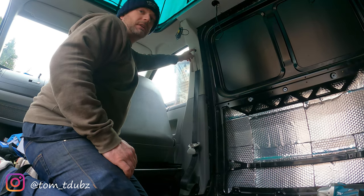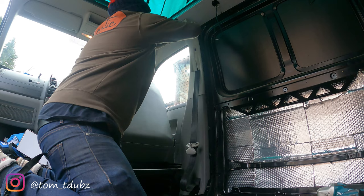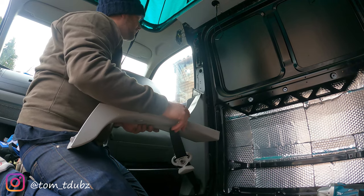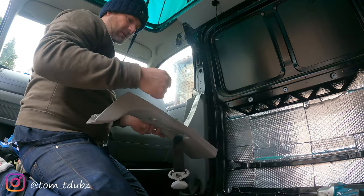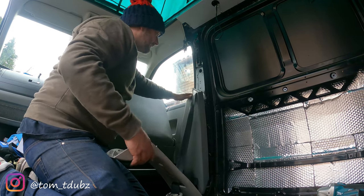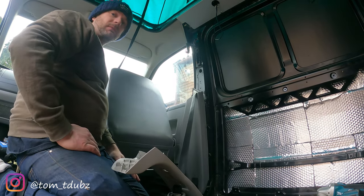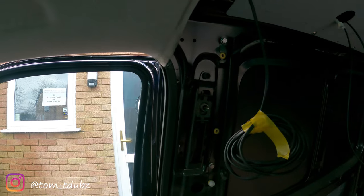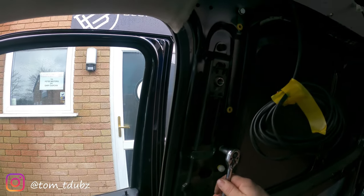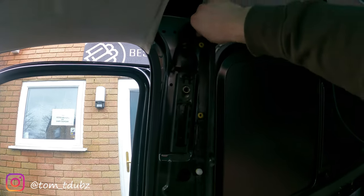Make sure you remove your seat belt. So this bit here is an M10 piece — gently start the top and you'll be able to pop it out. Now obviously if you've broken a couple of the white clips that hold it in place, they are available online. And then the same with the bottom one — give it a tug out. You may need to open the door slightly and just release it from that side too. I'm going to start with these top brackets, which are held on with three 10mm bolts. Once you've undone all of them, you'll be able to remove the top bracket.